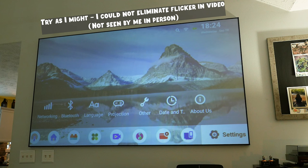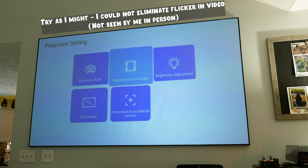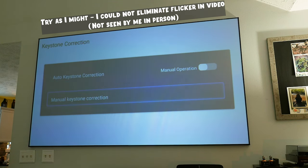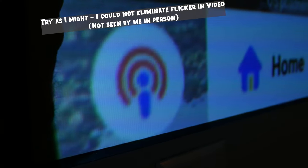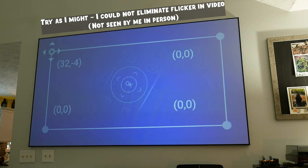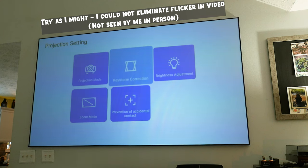The Q2 is a really lightweight 9.2 ounce — roughly 260 grams — ultra compact portable projector with a 5000 milliamp hour battery. It utilizes Android TV 7.1.2 in desktop mode, has 1GB of built-in RAM, 32GB of built-in storage, a smaller SD 540p DLP DMD chip that can upscale to 1080p — though you'll get significant screen door effect — and it offers a boasted 150 ANSI output on max brightness.